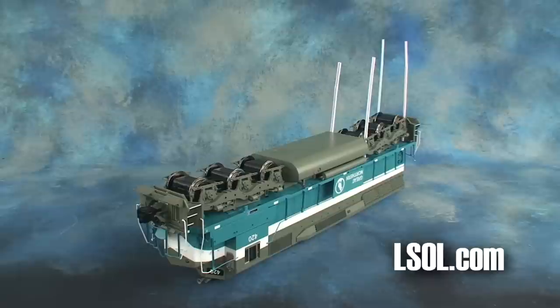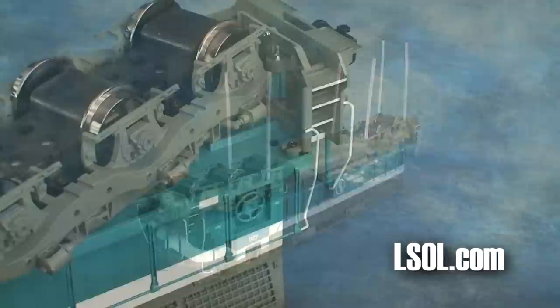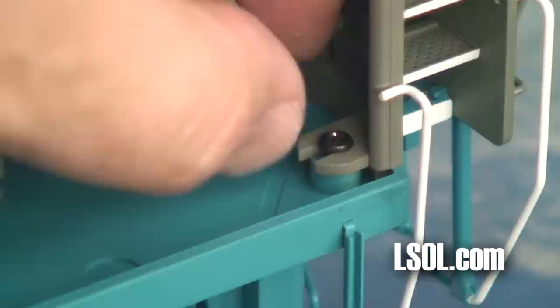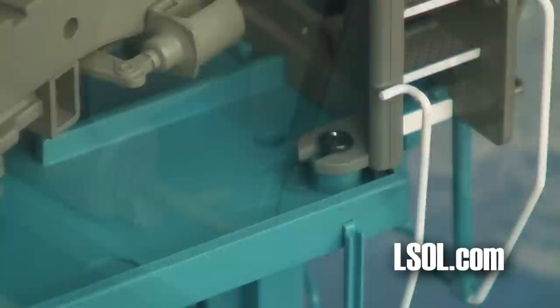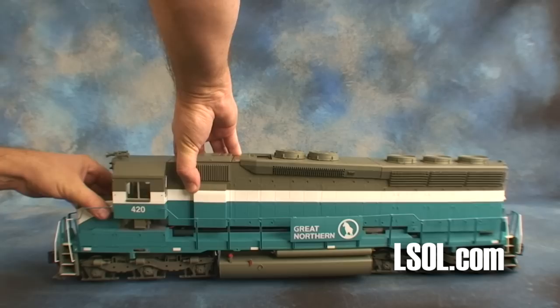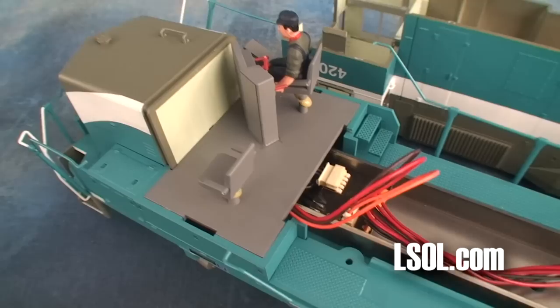It looks great on the outside — let's take a look on the inside. There are six screws that you need to remove to take off the top of the unit: four in the back and two in the front. Make sure you only take out the screws that have an arrow — there are only six screws and six arrows. If you start taking out additional screws, other pieces will come loose. If you've already installed the handrails, make sure you take them out of the side of the cab and pull them away so you don't scratch up the paint. Then, if you just slowly lift by the front evenly, you'll be able to take the top off. Don't pull too far because there are wires connecting the top to the bottom.